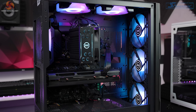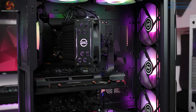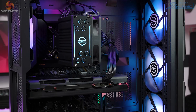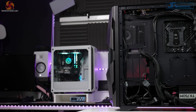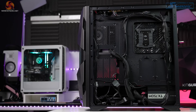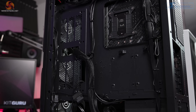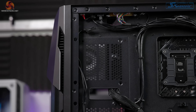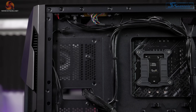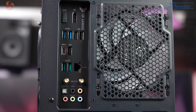Cable management has been done well. There is a bit more headroom above the motherboard so you can see more of the cables than if there were a radiator along the top, but personally I like having that access. Looking at the back of the PC, PC Specialist has really made an effort to keep the system tidy. The cable tidying is great despite the semi-modular power supply. The lowest intake fan is unobstructed by any panels or cables, so it can pass cool air over the hard drive and the PSU too. There are also a couple of mounting slots on the back for SSDs if needed. Overall the build is very clean, well cable managed, and installed with care.